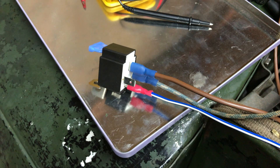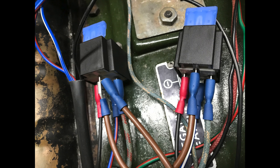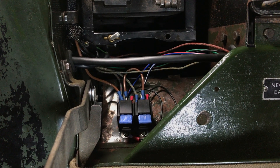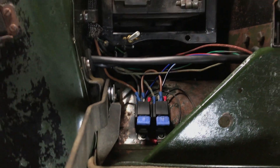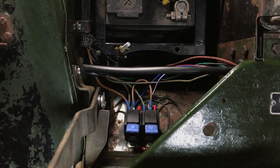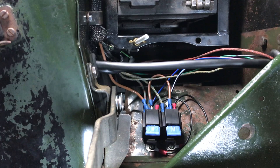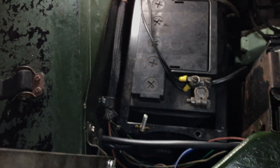I will now set up my dip relay, and then I'll get those two relays installed down there. I've tidied up all my connections. The relays are in now, tucked away down there - both fused. With a full-screen view it might look like there's a lot of wiring, but there's nothing there that is not needed. Just need to shrink that down - that's the headlamp harness. I've got some loom mesh to keep all the wires tidy down that side. It's a lot better than it was.